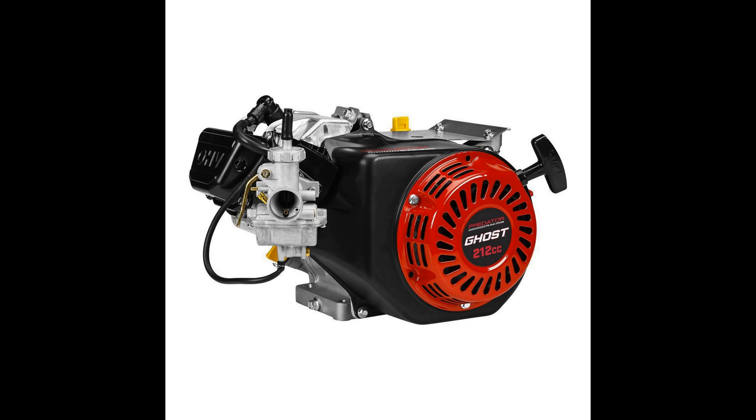Because this is a higher resolution image, I'm able to see a little better. There's some extra shielding up to the top right of the carburetor, so the blower housing may be a little different, or that may be an extra piece of shrouding to circulate more cool air around the cylinder. This one also has a piece of shielding up at the top area around the spark plug that covers the top side of the cylinder — we've not seen that before. That would also increase airflow around the cylinder and promote cooling.